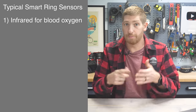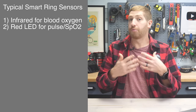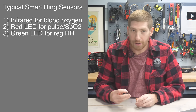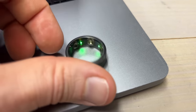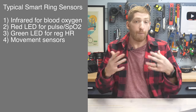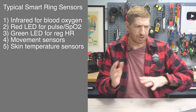The entire sensor package in the Oura ring — and probably the Samsung Galaxy Ring — has essentially five different sets of sensors. Number one is infrared, those little bumps, invisible to the naked eye. Number two is red light in between those bumps, used primarily at night for blood oxygenation levels. Then there's green lights — I've actually turned those on on my ring here — primarily used for workout heart rate and spot heart rate checks. After that, accelerometers and gyros to track movement type.